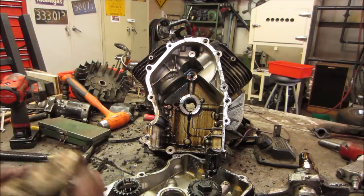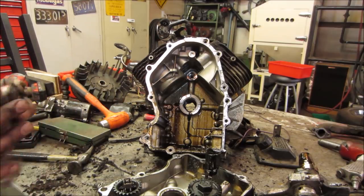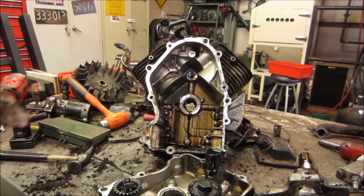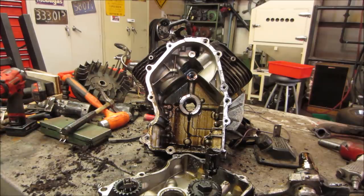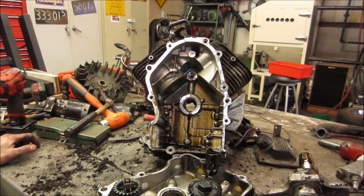So that's how the RPMs try to maintain this out, because most of the time on power equipment, it's not like your car. It's not like you're trying to work the gas pedal to work your speed. You're trying to maintain an RPM for whatever the load is. So say if you got a lawnmower going and the lawnmower is cutting grass. First, you're not cutting any grass, and you're just trying to drive it across the lawn. And say the engine's running at 3,600 RPM, full throttle, and tries to maintain that RPM. Without the governor, if you just revved it to full throttle, it'll just rev so high it'll blow up. There's nothing really stopping it from what its max is.